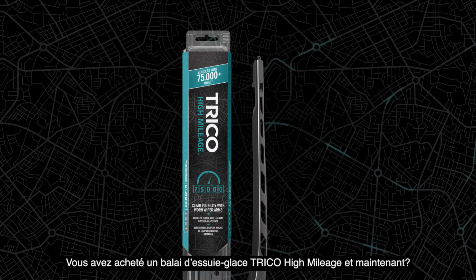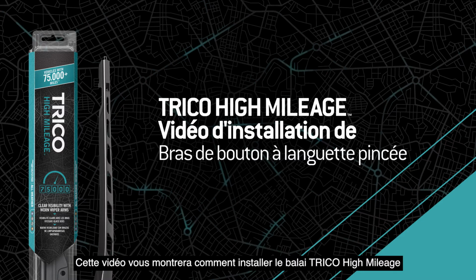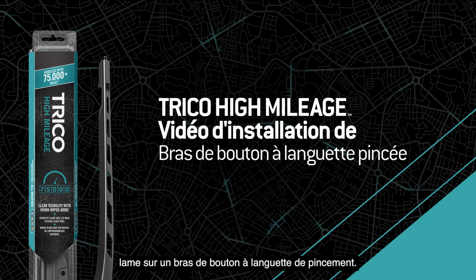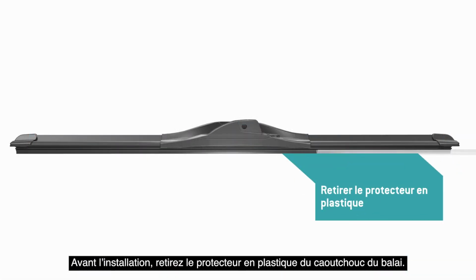You bought a TRICO High Mileage wiper blade. Now what? This video will show you how to install the TRICO High Mileage blade onto a pinch tab button arm. Before installation, remove the plastic protector from the blade rubber.